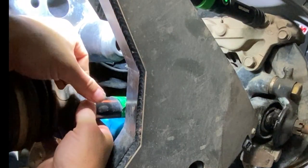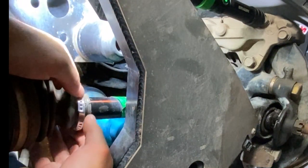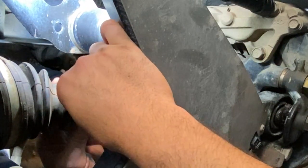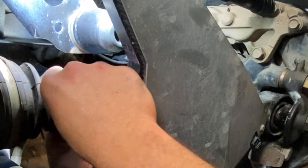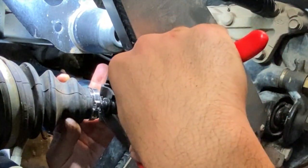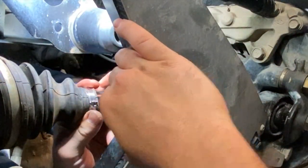You kind of want to get it as tight as you can, getting the slack out of the band. Lock that in and keep it pointing down so I can reach it. Pull it down to where I like it. I've got my teeth lined up. I'm holding the boot right here so the two aren't touching, then I take my tool, open it up — what the tool does is basically crimp this piece to tighten it. I'm just going to crimp this nice and tight.